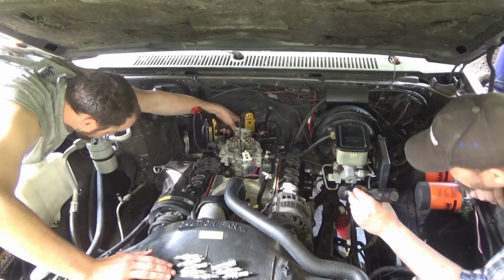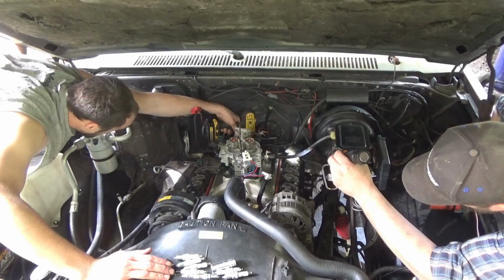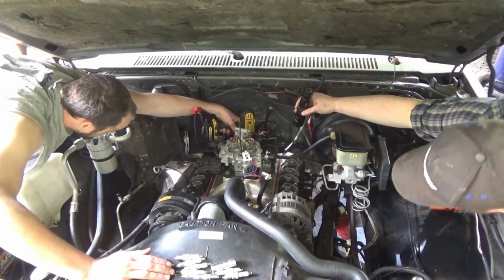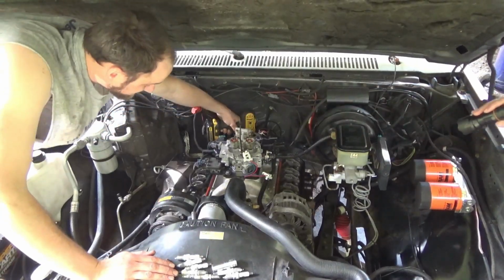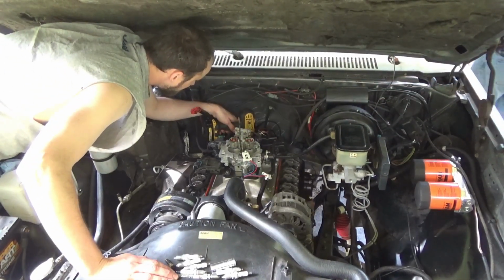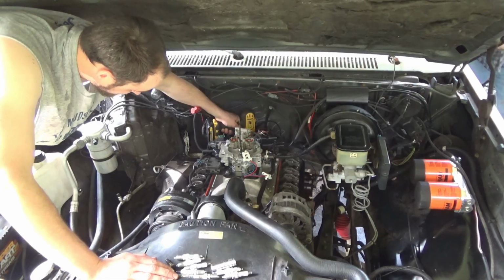It's got oil in the rockers, coming out of the holes in the... Looks like it, all the way across, about the back one. Can't tell from this angle. I got a brake thing in the way. Can't see. Is it still holding pressure on the gauge? I don't know, I turned everything off. Yeah, we got oil on every rocker. The fuse is off in my pocket and I'm still hearing the fuel pump.